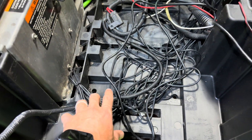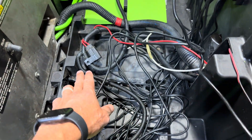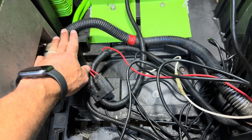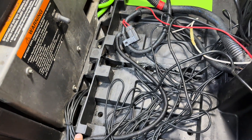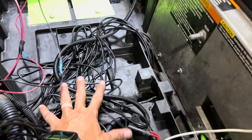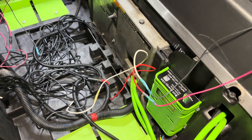It's very important that you keep all of your wiring harnesses as low to the battery tray as possible. The side ridge piece of plastic is where the battery will basically sit down, so make sure there are no wires over that piece of plastic. Get everything down low and hide all the excess wire in the space between the battery and the battery tray.